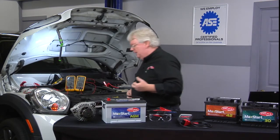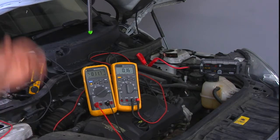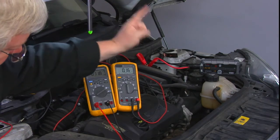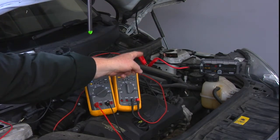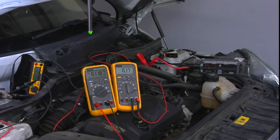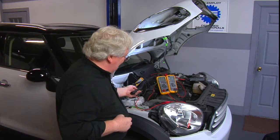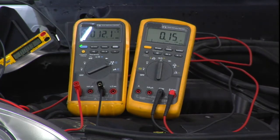What I want to do is give you a tip on how to find if you need to go the extra mile and hook up all of the parasitic current draw testing apparatus. So let's walk over to this Mini Cooper. We already took a booster box, powered it on, did the override so it would work without a battery present, and took the battery cable off the negative. I connected an ammeter in series with the battery cable, made sure I had a good fuse in that ammeter, and now we can see I am drawing about 12 milliamps of current.